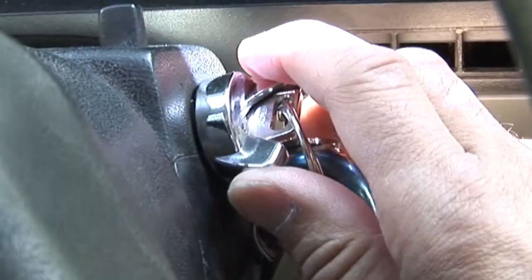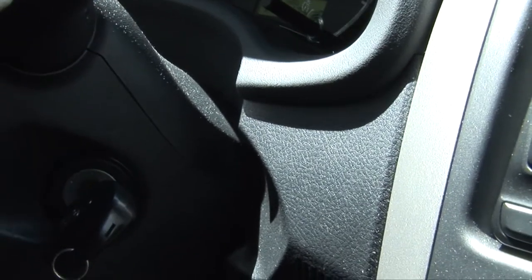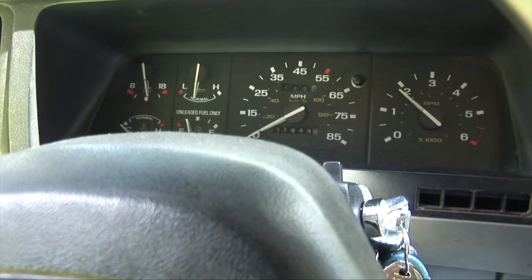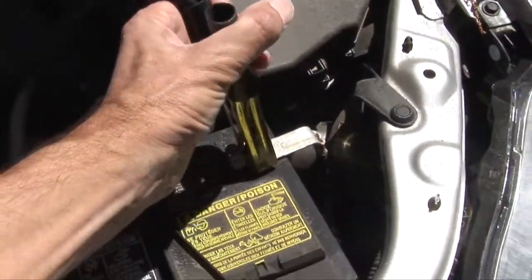Get in the car and crank it. If you're still cranking kind of slow, hop into the car with the good battery, start it and run the engine at medium speed for a minute or so, and that's it. It should run — you could be literally good to go. Remove the red jumper cable from each car, being sure not to touch metal. Then remove the black ground cable from each car.